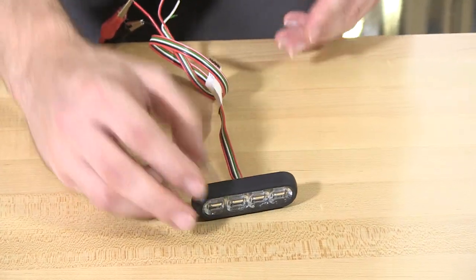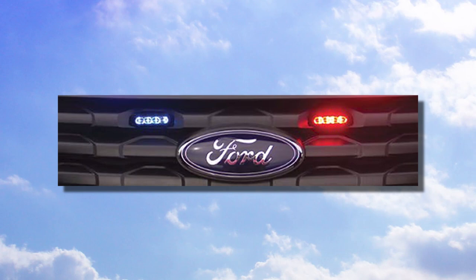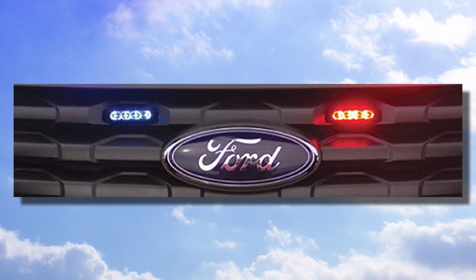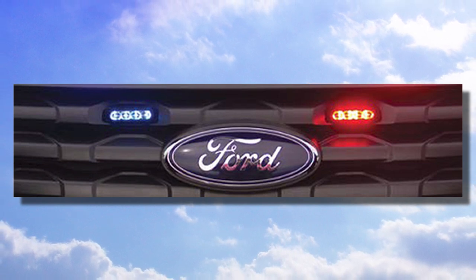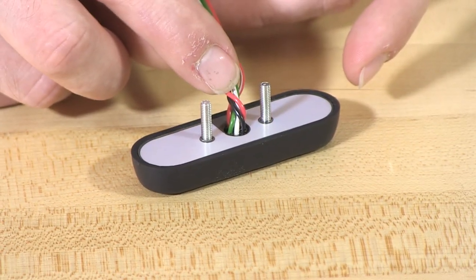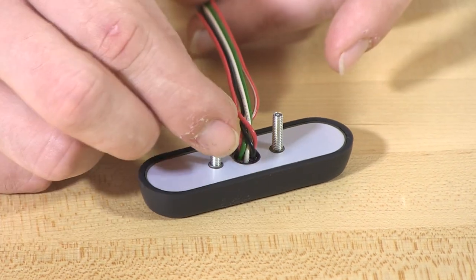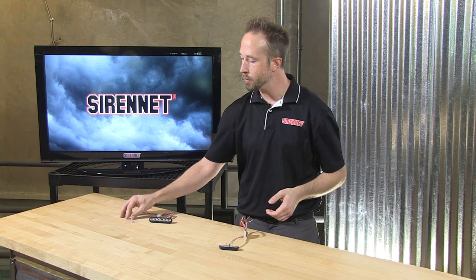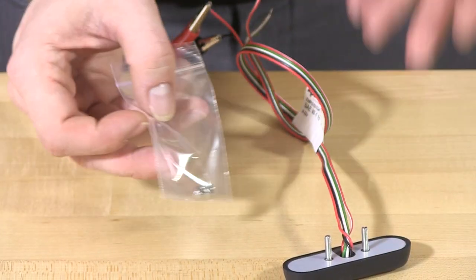With this stud mount, the most popular application is for the 2016-2017 Ford Utility Interceptor. This will go right into the service package front grille — slightly above the Ford emblem there are little pop-outs. Those will come out, and this head will fit right in there looking wonderfully clean, with studs right in line with the holes already punched by Ford and a center wiring harness to go right through as well. Then all you have to do is snug down the nuts on the back to affix it to the grille, and it comes with a pair of them so you don't have to go scrounging for hardware.